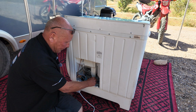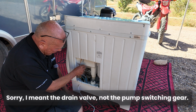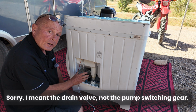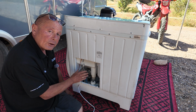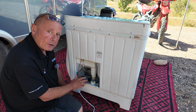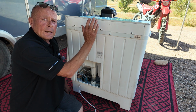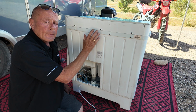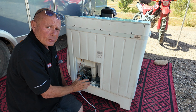This just lifts up and down. You also have the brake system for the actual spinner, and a few of these items we're going to need to disconnect to take the base of the machine off. This will expose the capacitor, the 2 motors, and also the gearbox. If you need to work on the electrical switches at the top here, this will be later in the video. At the moment we're going to take the base off.